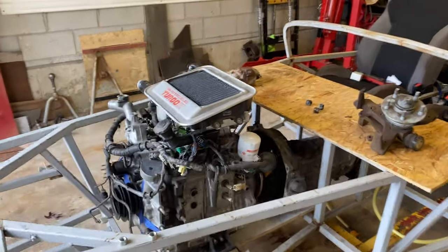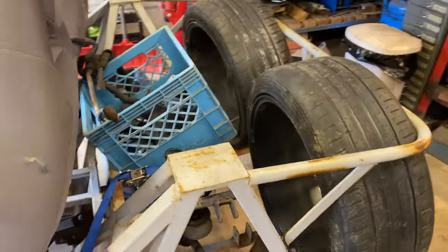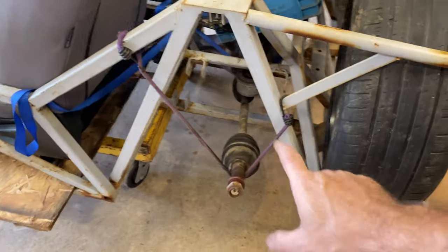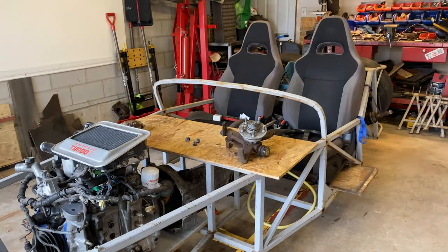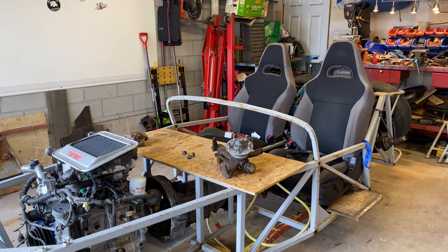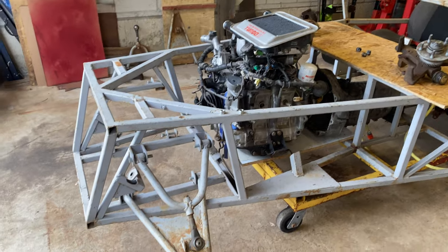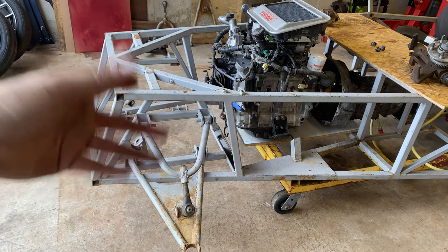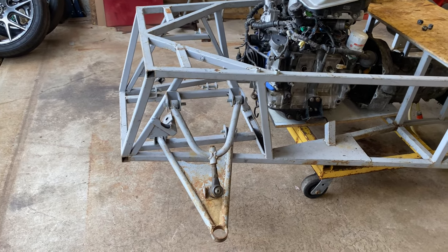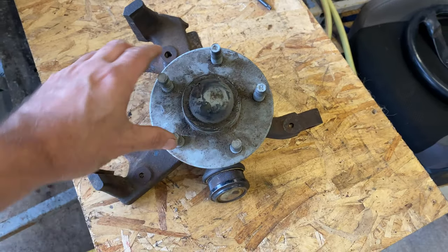Right. Epiphany number three. I mentioned before that I'm using an RX-7 turbo engine, RX-7 turbo gearbox, RX-7 differential, RX-7 rear shafts, and RX-7 rear hubs. The problem was the RX-7 rear hub stud pattern is 5x114 or 4.5, which is kind of like Ford - older Ford, maybe new Ford, I don't know exactly. And I was thinking I would need to get like Crown Vic front end hubs and all that shenanigans because that was the cheapest option. Because although these are Ford, they are earlier Ford and their stud pattern is 5x4.25.